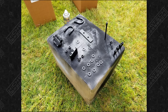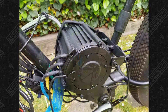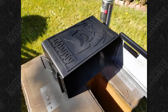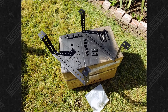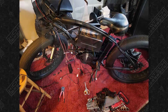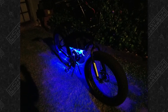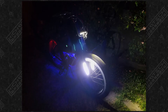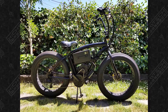I know it's hard to make a beach cruiser look aggressive, but with the chopper bars and how big it is, I think it actually looks pretty aggressive. After all the painting was done, the only things left to do were to finish up some wiring and reassemble all of the painted components. Because I didn't know anything about e-bikes, I figured if you get a giant motor you're gonna get giant power — but that's not exactly how that works. To feed that motor, you need a lot of energy and a way to discharge it very quickly. Because this battery was only 20 amp hours and had an 80 amp peak BMS on it, I was severely limited on power by the battery. So in reality, this bike was probably only putting out about 4 kilowatts, which is still a ton of power for a bicycle, but nowhere near its potential.